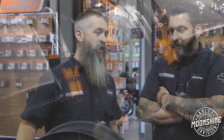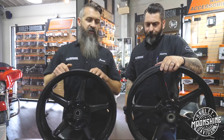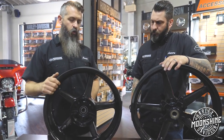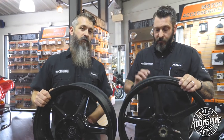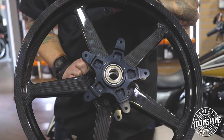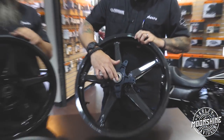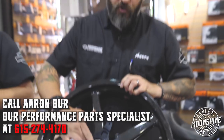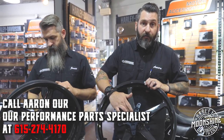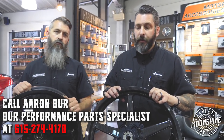Combined with one of the best suspensions — we like the Öhlins setup, we run Legend, we run Progressive depending on the customer. Something BST also does when you order these wheels: you order your bearings and they offer ceramic bearings. Ceramic bearings offer less drag, they're not affected by heat as much, and they operate without any real form of lubrication inside, so there's much less parasitic drag. Anything we can do to put more power to the ground is a good thing.